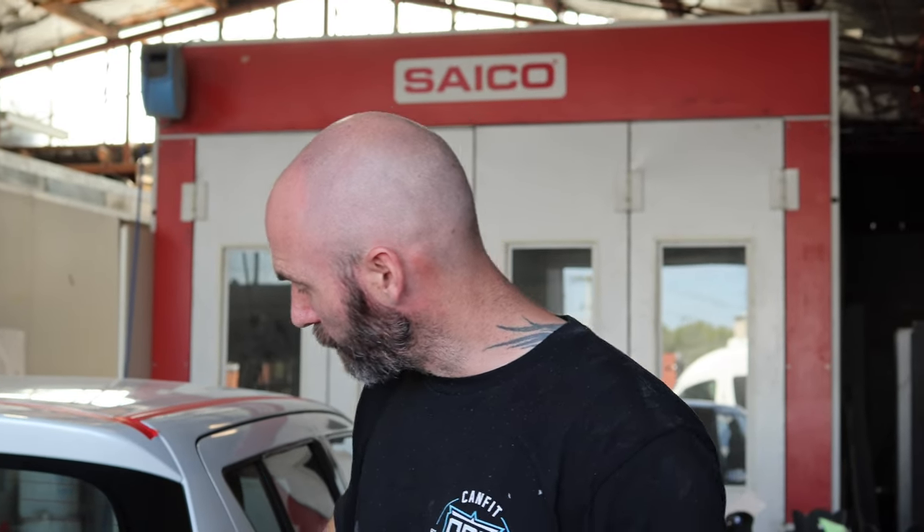So what's the story with this car? It was sold to a friend of ours we do work for. The paint has started flaking off — not uncommon for a car of this era from Japan to not like Australian conditions. Subarus, Suzukis, Toyotas, especially the headlights — they just hate the Australian sun. The sun is so much harsher than most countries. So the paint has actually started lifting and flaking away from the body. And the previous owner attempted to fix it by rattle-painting over the top of it. So we've had to take all that off, feather out the paint where it's not going to flake in, and then start again — reprime it, re-sand it, re-paint it, re-seal it.